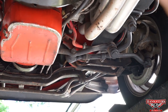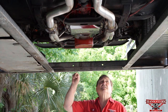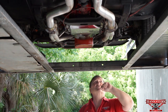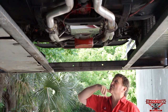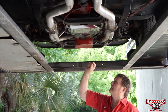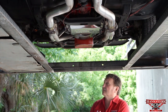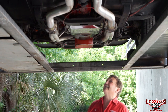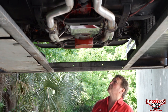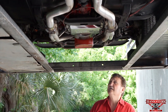Let's see, the steering box is original. The pitman arm is a replacement. The idler arm also looks original, but it doesn't need replaced. Torque gear reduction starter on it. Someone's fabricated a deep oil pan for this with a tunnel through it to take care of the steering link. I'm going to call it about an 8-quart pan, but it is a nicely fabricated pan.